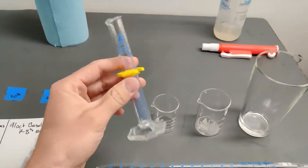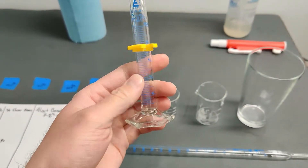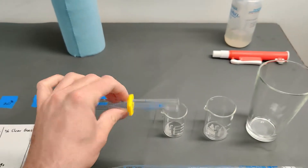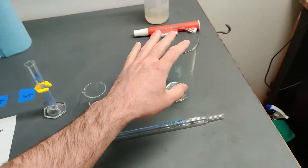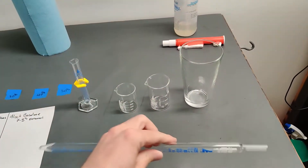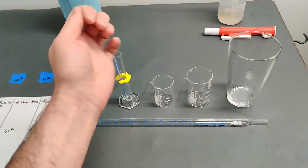Let me go over the test procedure. I have a 10 milliliter graduated cylinder, which makes it really easy to mix blends in 10% increments — I can just go 2, 3, 4, 5, 6 and so on milliliters of methanol, then fill it back to 10 with gasoline to get my blending in 10 milliliter batches. The sensor seems to hold about 5 milliliters, so I get a couple tests out of each fill. I put methanol in one container, clear gas in another, and the ethanol-gasoline in a third, and I use a 25 milliliter pipette to extract and pour into the graduated cylinder. Then I take the graduated cylinder, seal the top, and tip it back and forth to make sure it's fully mixed.